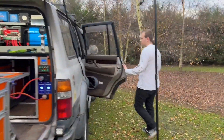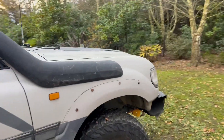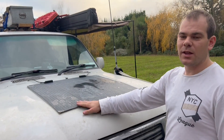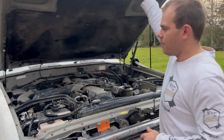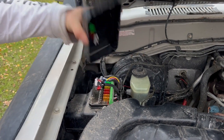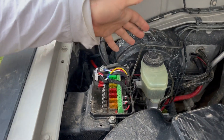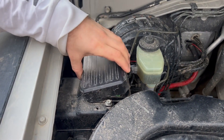These are the mini hubs. It's really nice to have one central place for all your electronics, but what if you've got a vehicle and you want some switching in the engine bay and don't want to run your light bar from all the way back? This is what the mini hubs are for. This one can be out in the elements — as you can see, I've got mud over it from four-wheel driving. It's an eight-gang switchable module using MOSFETs.